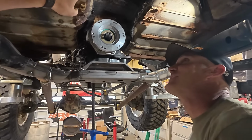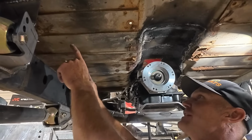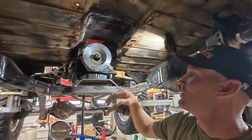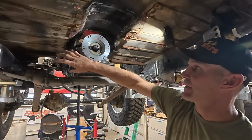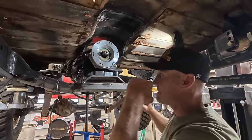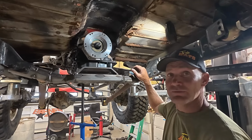So do we have to carve this whole thing? We gotta cut a section of it, the length of the transfer case out, and then we'll just put a rounded plate in it to match this. We'll just come over and roll it off on the end, and then the transfer case will be in it. The drive line has to be up above this, so we've got to roll it up enough to get the drive line to come across and somehow fit an exhaust through there as well.